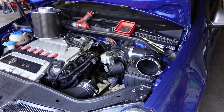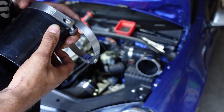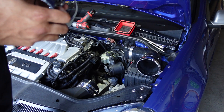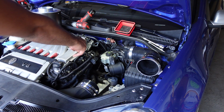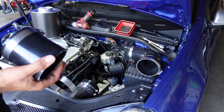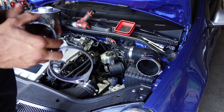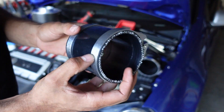I'm hoping they fit because they're a little bit thicker, so hopefully they fit behind. If you do have a forge intake on a Mark 5R, you may have already broken your plastic scoop — it's because the combi valve down there pushes the intake upwards, and the intake hits the top of your hood as you hit bumps. Then you break the intake scoop, which is most likely plastic on the later models they made. That's what it looks like with it on so far — let's slap it back in.